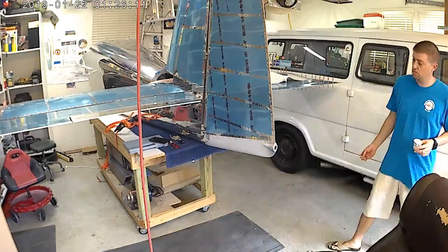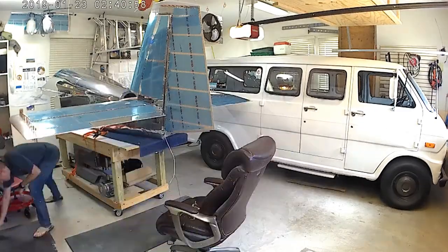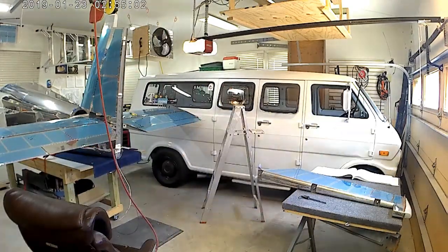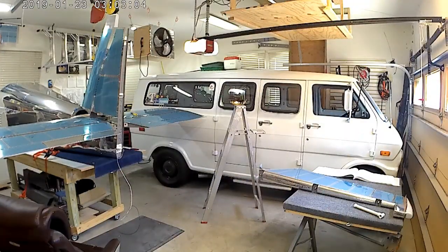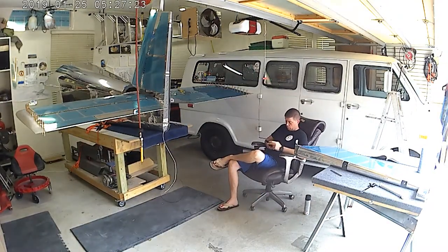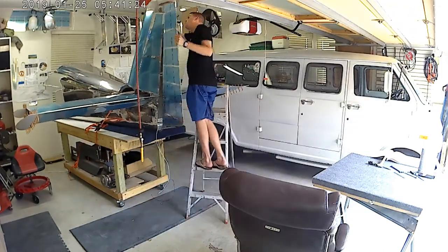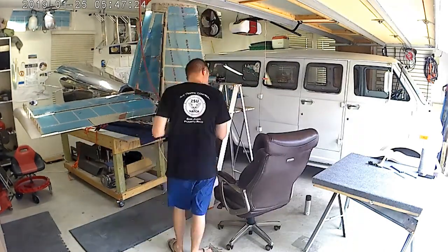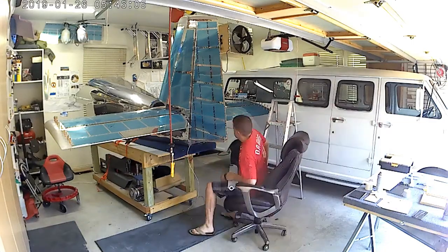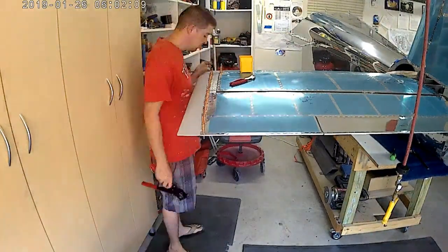Right there I was just drilling and tapping the thread for the bottom light. Towards the end you will see me using the pneumatic pop riveter from Aircraft Tool Supply to finish up and pop rivet all of the fiberglass pieces on. At this point I'm still at least three or four months away from receiving my wing kit, which is why I went ahead and did all the fiberglass pieces. I'm very glad I had that amount of time because a lot of people leave them for the last thing — and that's not wrong, but they are incredibly time consuming.